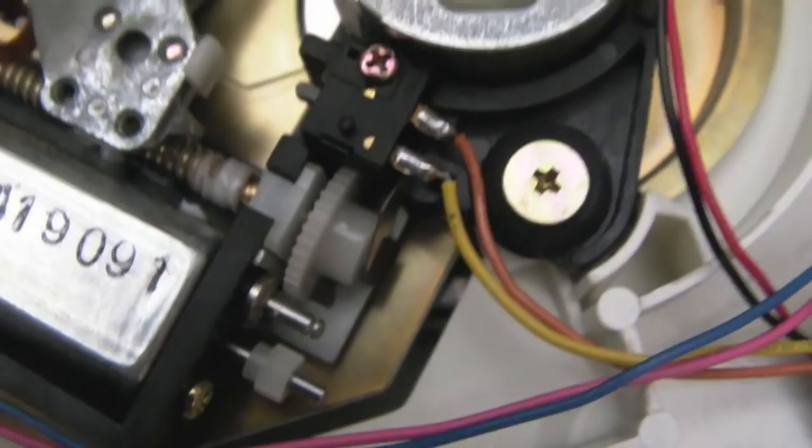Mission accomplished in terms of diagnosis — I'll just press play. Can you hear that? The gears are going round. So we do have a jammed carriage, and despite greasing up there's still resistance. But the chip is not warm now — we did have a jammed carriage after all.